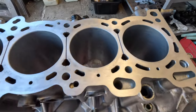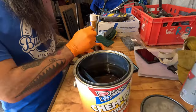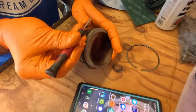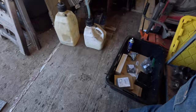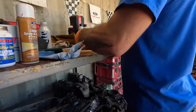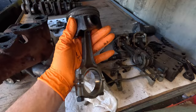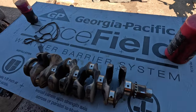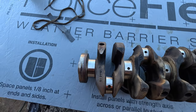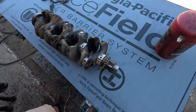Block is looking fantastic. All of the cylinders are honed, cleaned, and aired out. Same with the head - looking good. Now we're on to pulling the rings off the pistons and dipping them in this Berryman's Chem Dip - we typically use this for cleaning carbs. Not going to leave it in too long, just enough to break all the carbon and crap out. We have a new set of OEM Nissan rings for all pistons. Also going to polish the journals on this Infiniti G20 crank with 600 grit up to 1500 grit to get the old bearing material off so the new bearings start fresh.